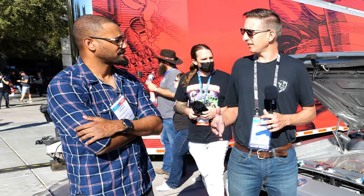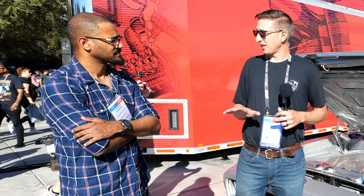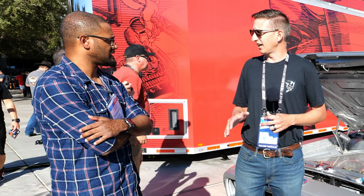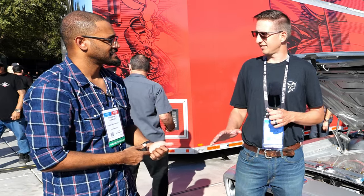This is a full build — I used the whole Model S subframe in the rear with cantilever suspension. The balance is a little heavier now; it's 4,300 pounds, about 300 pounds heavier than the big block car. But it's 55% rear weight, so we're getting into the sports car category of handling. And that's 600 pounds lighter than the Tesla I pulled the parts out of, so this thing's just flying.